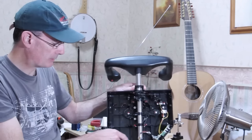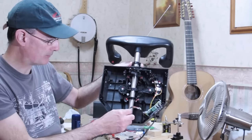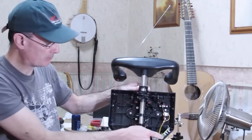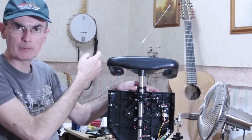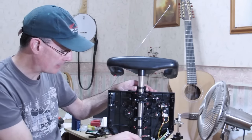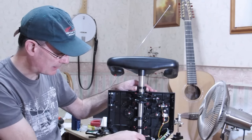except just to point out that at the end of this shaft, right at the bottom here, a very hefty bundle of wires comes out. That goes all the way through the shaft. Well, it goes from this controller board here, this is a joystick controller board, all the way through the shaft up into the handle. Now we're going to see the other end of that bundle of wires in a little while, and we've got to work with that. These are tiny, very thin wires, so they are delicate.